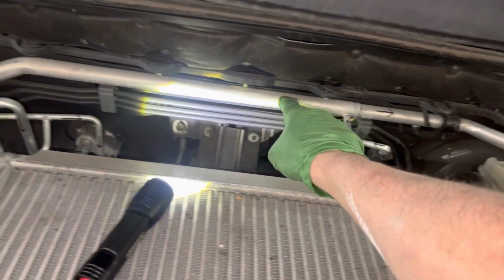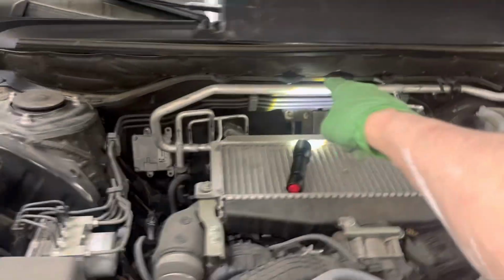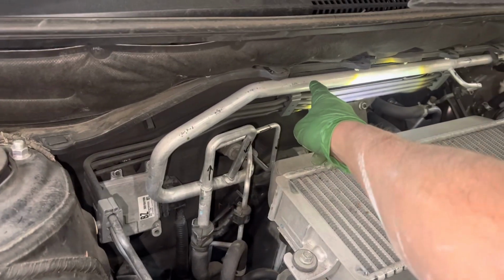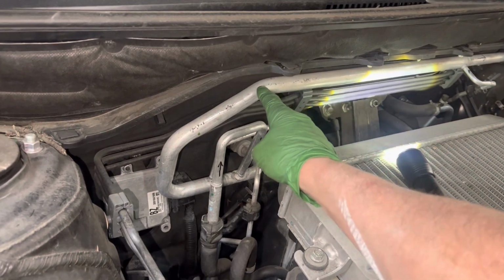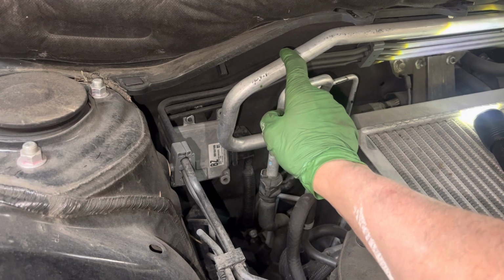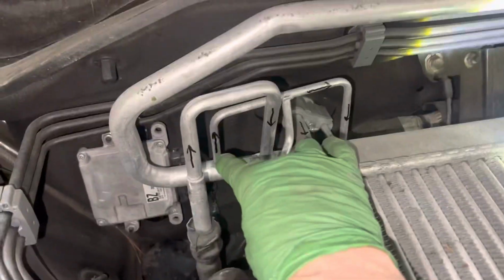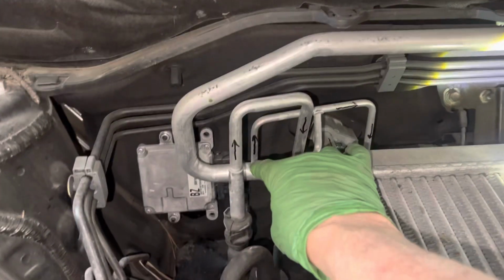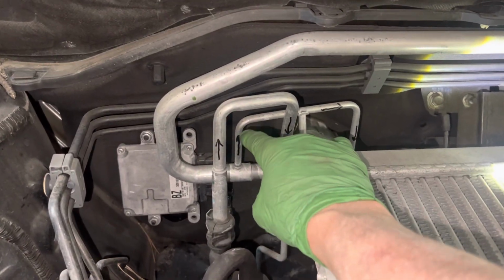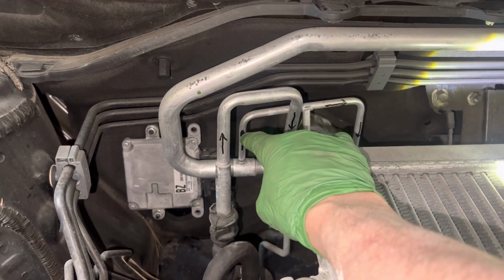And it's going to make its travel all the way down here, and you've got about 2.5 feet of line where liquid hot refrigerant, warm refrigerant, is traveling on the outside of the cold suction line. And as this approaches its discharge right there, it is now chilled down a few degrees. And this liquid refrigerant is now usually colder than ambient, or at least the same.